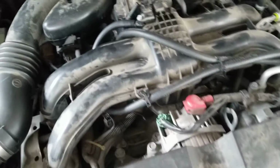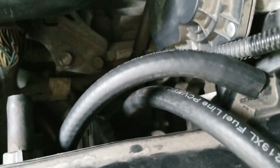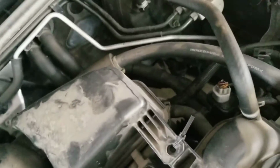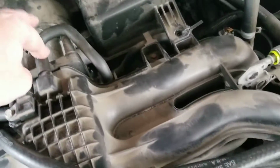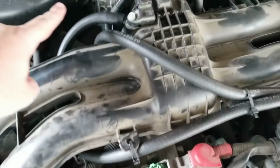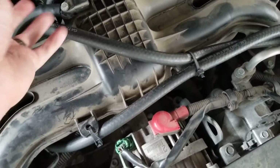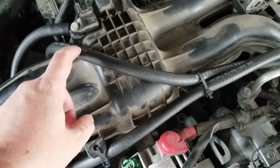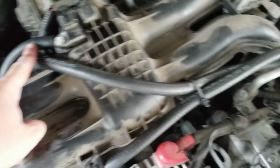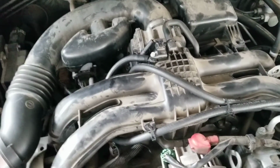So down in the Subaru, if we go down here, that is our exhaust for the PCV. The intake for the PCV is not over here, I think it's right here. So that's actually our intake for the positive crankcase ventilation, and here is our exhaust going back into the intake. Like I said, I don't like that Subaru has it. Here is your pressure sensor. It has a membrane, I don't think the oil is going to affect it too much, and it's made to be there. But that's your pressure sensor, and then there's your exhaust with oil in it and everything from the PCV. So not the greatest.